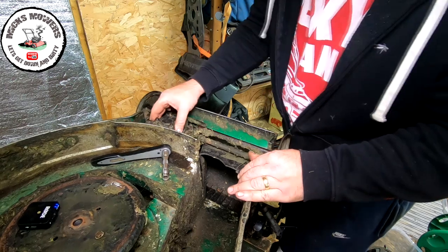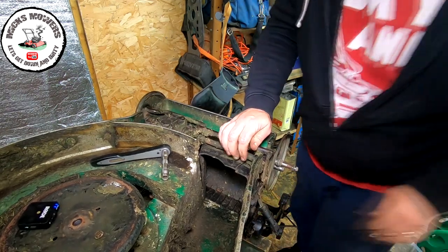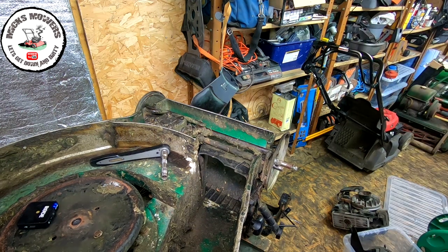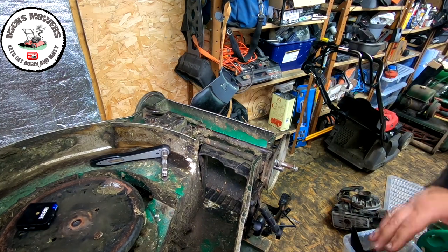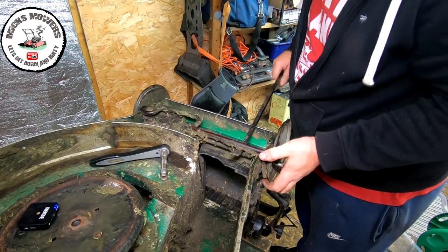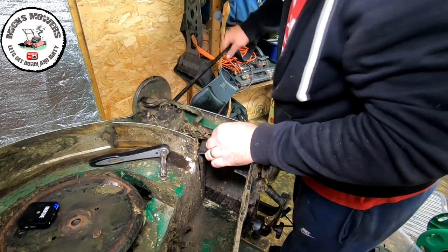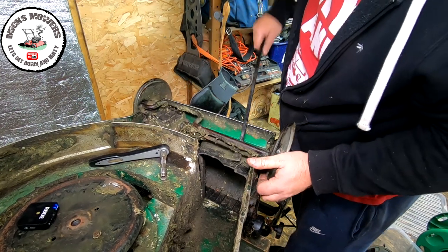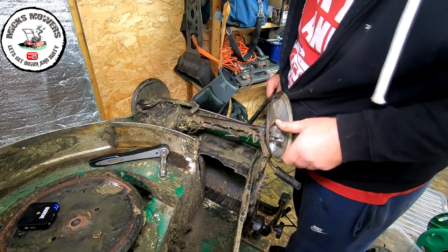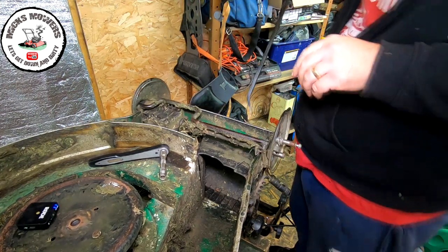So the gearbox is now loose that end. So now, by rights, we should get a pry bar. Start to, I believe, have this gearbox out. Here goes one. Two. That's it. Gearbox is now coming out, but as I say, be a bit wary of that drive cable that's been held on.